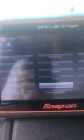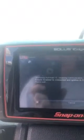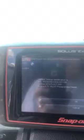The first thing you want to do is take this over to Ford Auto ID. Initially it's not going to detect the ID because it only goes to 550, so we're going to take this down to 550. You want to select the diesel, because the 6.8 is the V10, so we go, of course, diesel. See, now it detects the entire VIN number of this very truck, so we're going to hit OK.